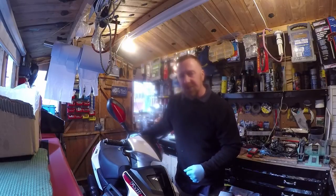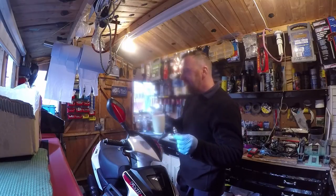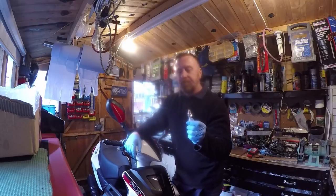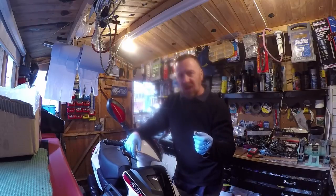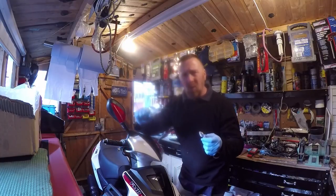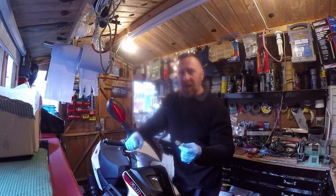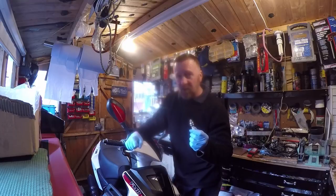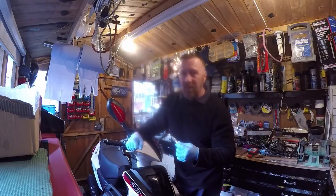Normal 10/40 motorbike oil is perfect. It hasn't got a wet clutch system, but you must do that. As for the plug — you're going to notice you need it because you'll take longer to start and you get this sort of bogging down when you pull away. It's this little bugger here. And the air filter — we'll have a look at that in a minute. I haven't got a replacement so I'm hoping I can take it out and give it a clean.